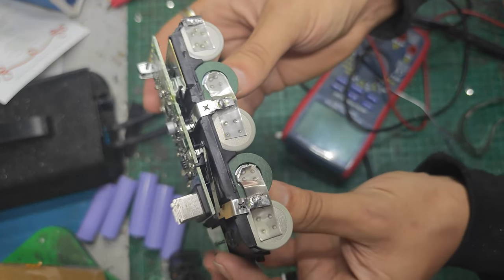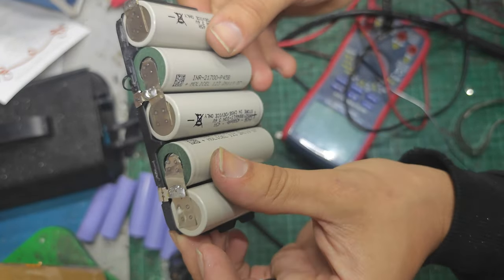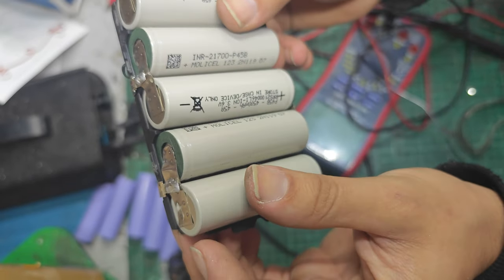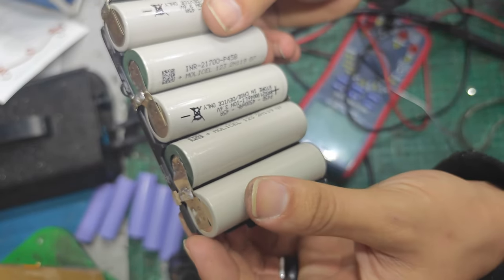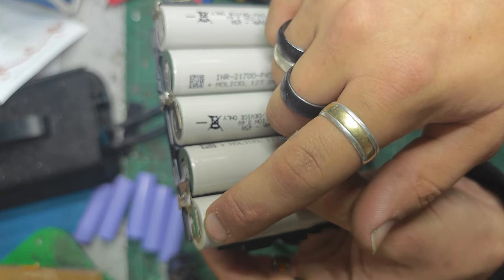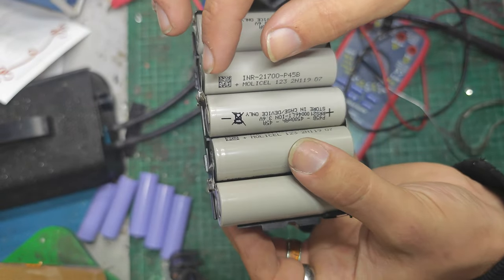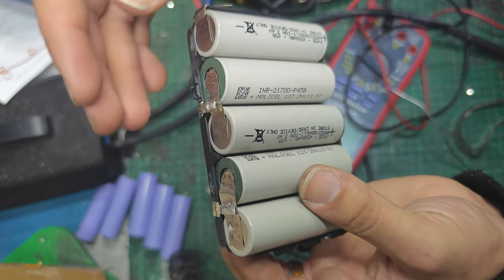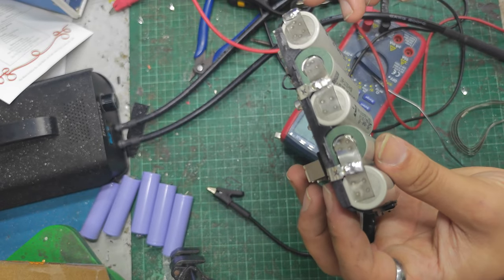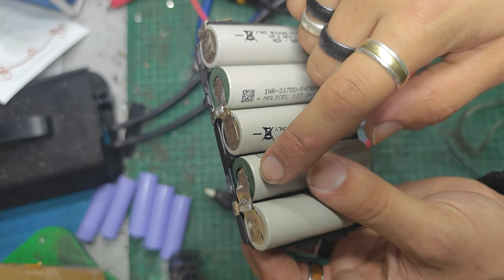Looks awful. What I think I'd do differently in future is, you see how I've managed to get this strip really nice? I think I've left a step in it like they did. I'd probably make up the strips first, maybe in a vise or something, so that they have this over, up, across, down, over type step to them. I think that'd look better. If you were doing it loads, you'd come up with this. You'd step it up and over probably.